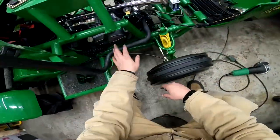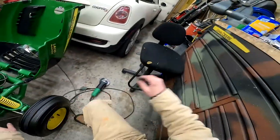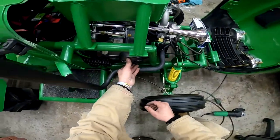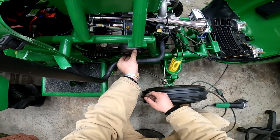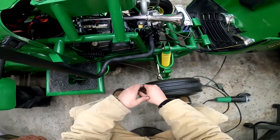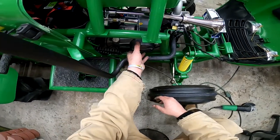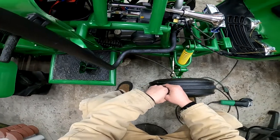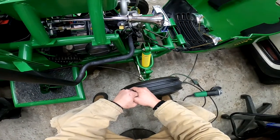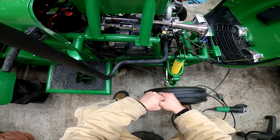But in other words, if that clutch had overheated, those plates might be no good anymore, and it might continue to slip and overheat until it wears out and it no longer works. I can get a new one. They're like $35. Then I gotta drain the oil, take that off, take this off. Yeah, no more fun, not fun, but we'll see. Not a big deal though. I can do that.